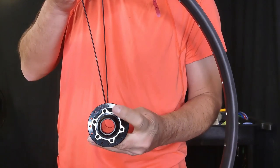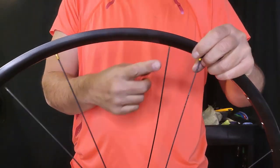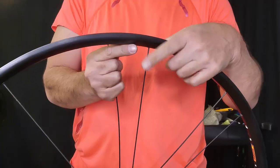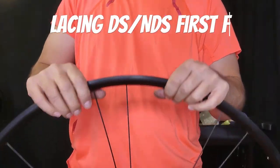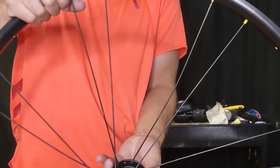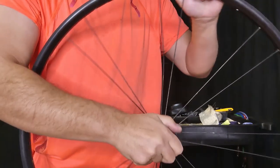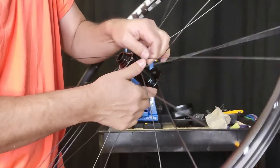The non-drive side spokes were a little longer. I've just skipped over the first set of spokes and moved over to the second set, but you can see that that spoke is a little tight. We just follow the pattern. I skipped over that second set because it's simple, but it's mostly because we run into this problem here with the spokes — for some reason they're too tight and I can't spin the hub. The cross spokes on the disc side are a little stiff, so I have to bed them in.